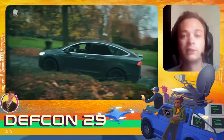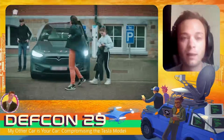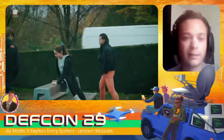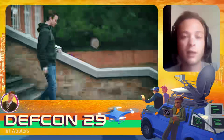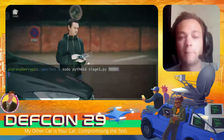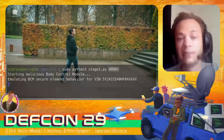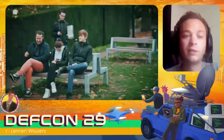To end this presentation, here is a demonstration video of how we would actually conduct this attack in practice. In this scenario someone is parking their car in front of our university building — maybe going to charge it and then go for a walk. Using our tool, we approach the parked car and read the VIN number from the windshield. We enter this VIN number in our Python tool, which allows us to emulate the BCM, giving us a BCM that believes it belongs to that same car. We can then use that BCM to wake up the key fob in the owner's pocket.